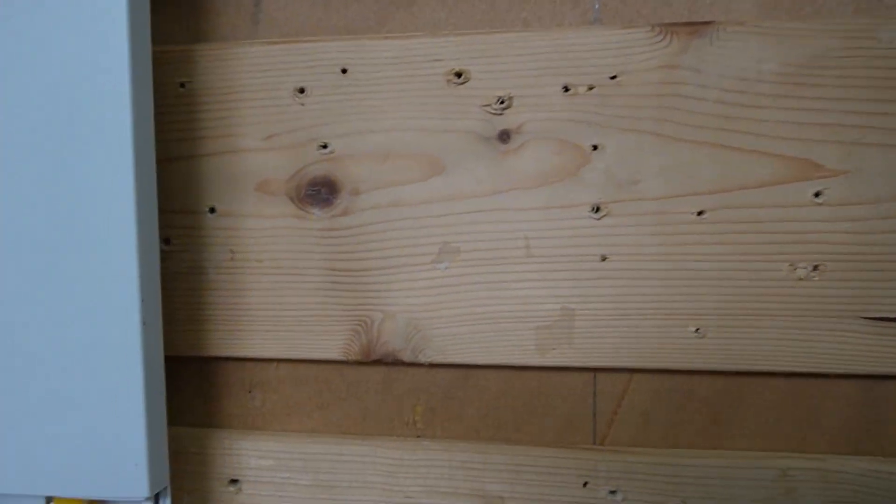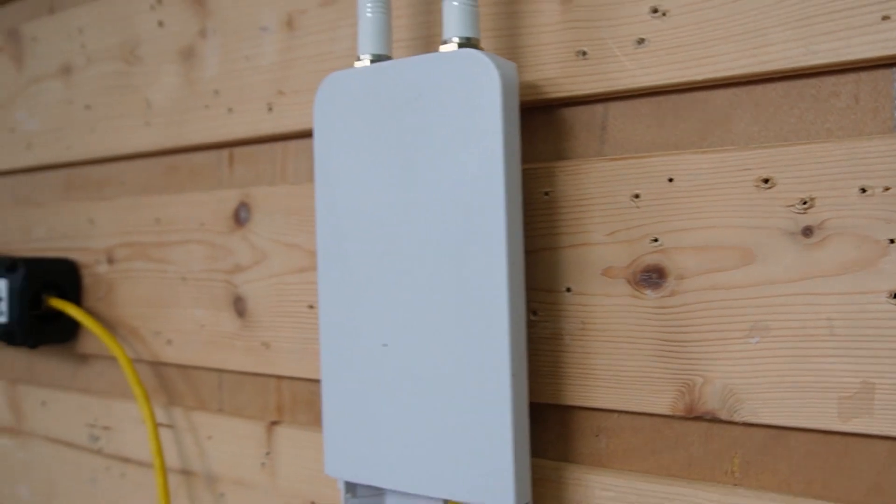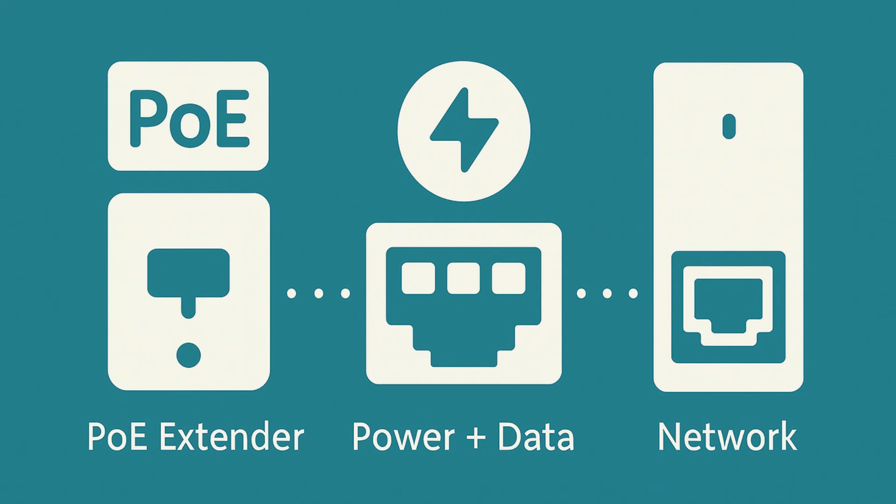Alright, let's check it out. We ran a cable from the router to the access point. At first glance everything seems fine, but no lights on — nothing passed through. This is what you'll see if you forget about PoE on the front end. The problem is there's no PoE feed. Our extenders are PoE-powered devices, so they need to receive power over Ethernet in order to boost power and data down the line.